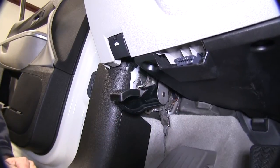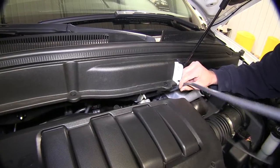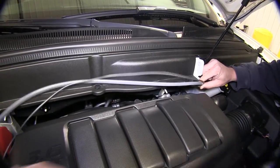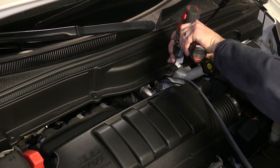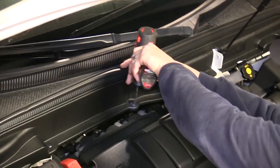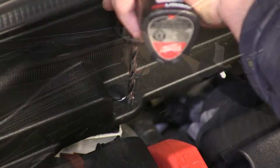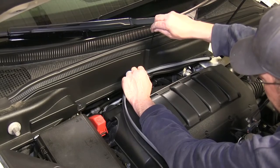Now we'll move into the engine bay. Here we'll take the black wire and the gray duplex cable that we added additionally for the power and ground for our brake controller. Next we'll need to run them over to the passenger side where we can make connection with power and ground. To do this, we're going to drill three small holes in the plastic trim panel going across the top of the engine bay, then take some black zip ties and secure the wiring as we route them over.